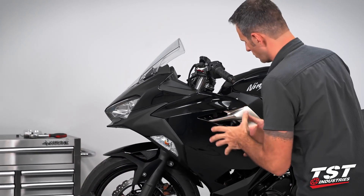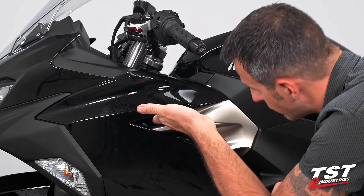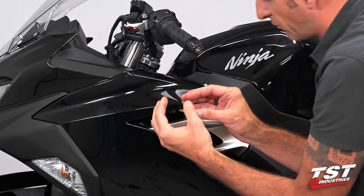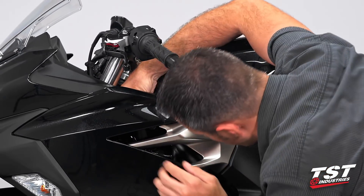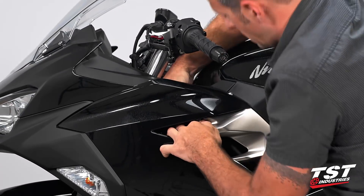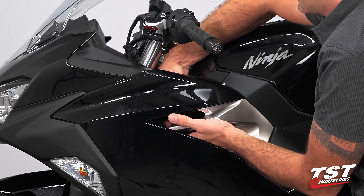The first thing I'm going to do is show you guys exactly where the OEM relay sits. If you stick your hand in through here, the first thing you will touch is that relay. It is mounted via rubber keeper onto one of the tabs that are welded onto the frame. So first, we'll need to dislodge it, pull it up, and then wrap it back around a section of frame that's over there.